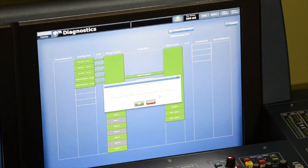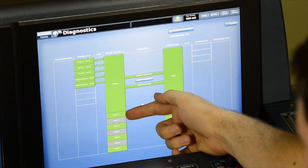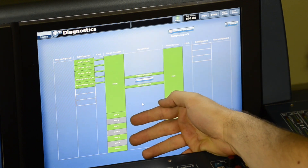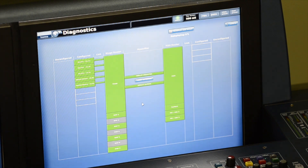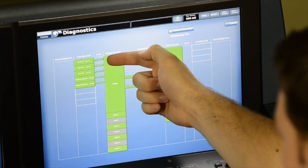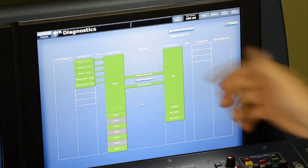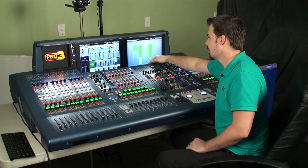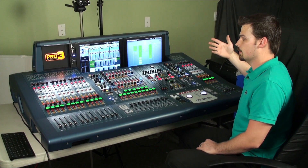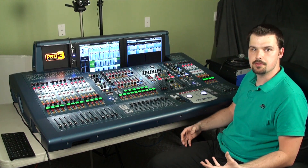Currently I'm using the X network, and I can swap to Y. Under stage router, we have the stage and seven DSP card slots. My Pro 3 has four DSP cards installed, with three slots empty — if I wanted to upgrade to a Pro 6 or Pro 9, they'd send me DSP cards to install in those slots. And finally, here are all five connections from the DL371 DSP engine: the first three are the DL251 stage I/O, the last two are the generic AES50 devices for the DN9650, and the remaining three are the open AES50 ports at the bottom of the DL371. Now that everything is configured, we're ready to move on to the next section.